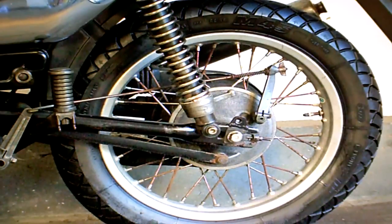There's a spoke nipple broken on this rear spoke. I would think if you were careful you could fix that in situ — just let the tyre down. You might have to take the tyre off actually, because there's bound to be an old spoke nipple inside. Just put another nipple on there, straighten up the spoke, and that's probably going to be okay. Tighten up the rest of them while you're at it. That will need doing for the MOT.